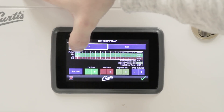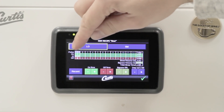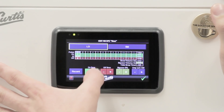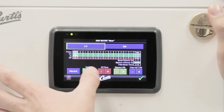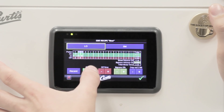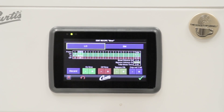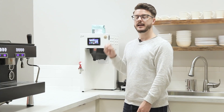What this is doing is it counts out a number of pulses from one all the way up to 12. A pulse is the brewer dropping a certain amount of water and then stopping. So you add in ounces — for example, have it on for say 20 seconds, and then in the next category set your off time. You could have it do a pre-infusion for 20 seconds, bloom that coffee, wait for 20 seconds to let it fully bloom and let all those gases come off, and then hit it with more water.